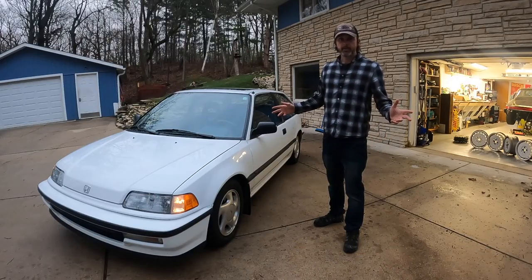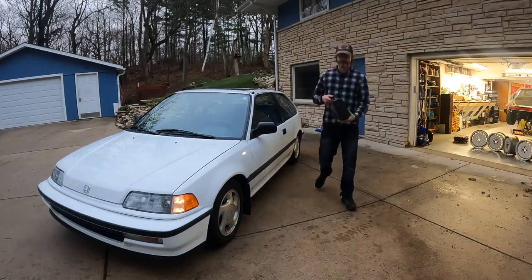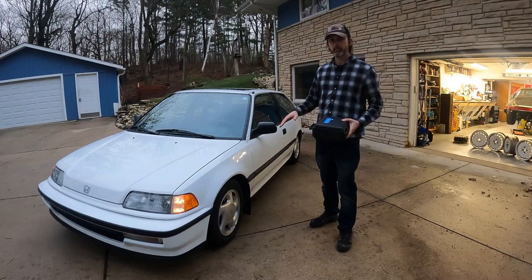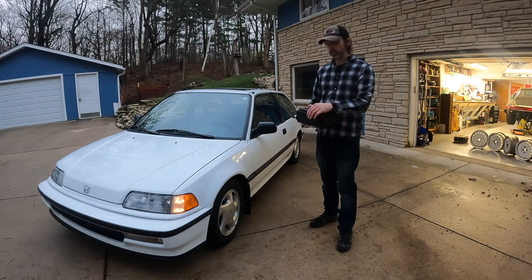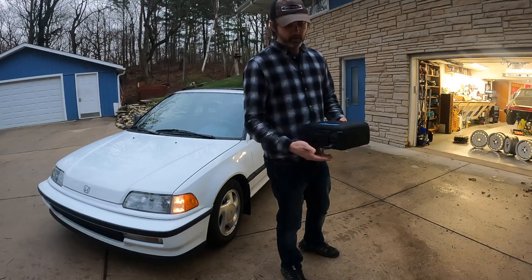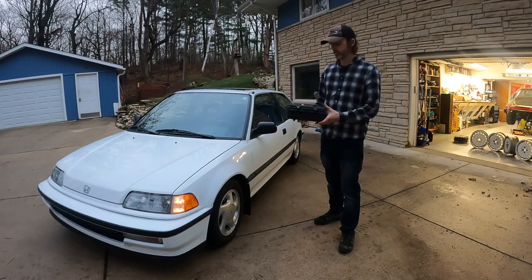That about wraps up this episode for the Civic — I think the paint turned out pretty good. Next up, we are going to do a leak-down test. There have been signs of oil consumption in this car. I haven't experienced any oil loss yet, but occasionally when I start it I see some black liquid behind the tailpipe — so somehow oil is getting into the exhaust system. That could be the rings or the valve seals. I picked up an OTC 5609 leak-down tester. I used a Harbor Freight one on the 911 and that was pretty horrible, so hoping for a better experience with this.